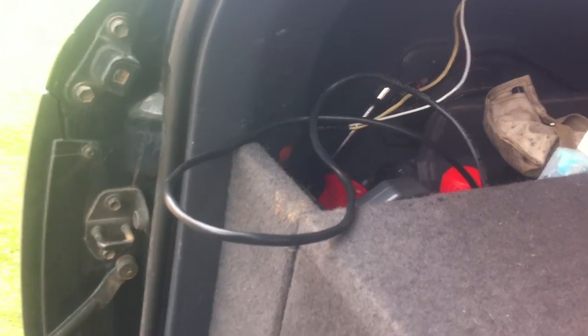The black cable I used is again just some, if we can read that, Nava trailer cable. It's 5 core, but you could use any sort of 4 core type automotive cable. So I've just basically joined colour for colour, and then I've put the male plug on the end. This way it's not hardwired. I sometimes take my roof rack off and on, so I didn't want to have it all hardwired. So that's why I went for this option. There is probably a slightly easier way, which I'll explain in a minute, where you don't have to run a 4-wire cable.